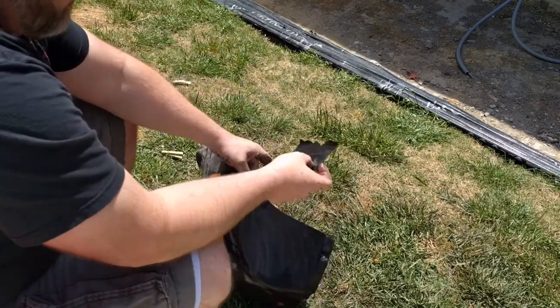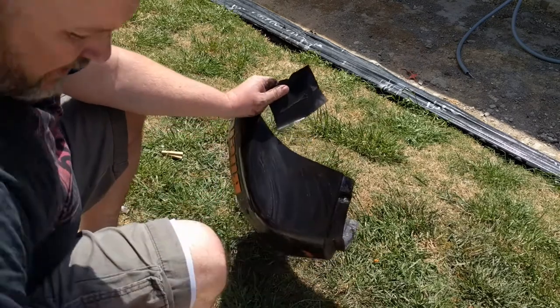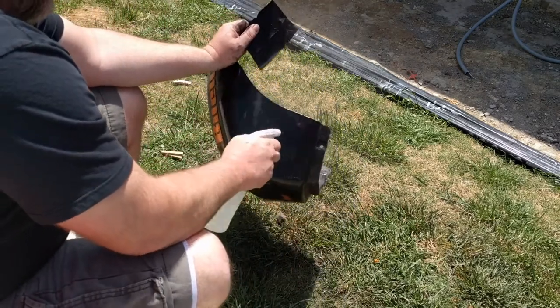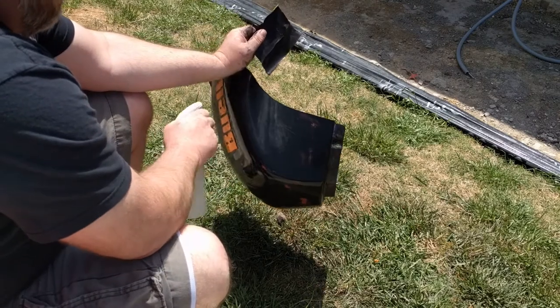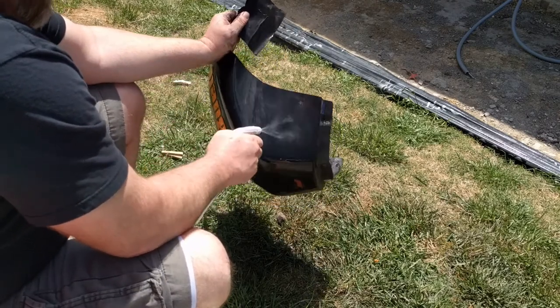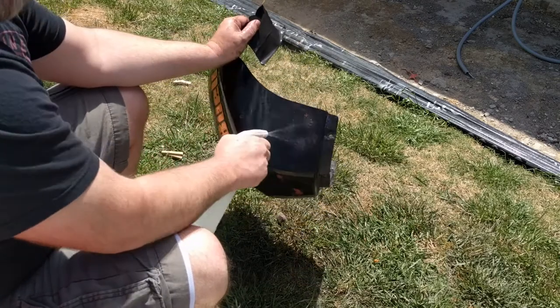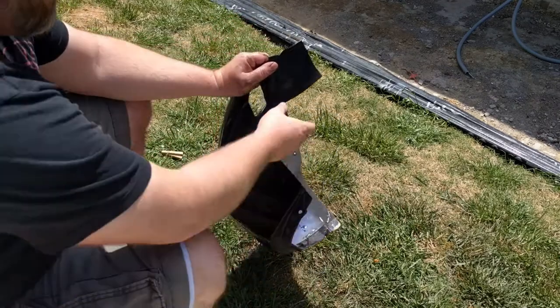You hear that and suddenly it gets quieter - that's what wet sanding does. It takes off a lot of the higher layers and rough spots in the paint, and you're left with a much smoother paint surface. And the result, if you really go at this - if I wanted to have a show bike, I wouldn't be going this fast. I'd be really taking my time.